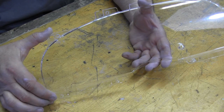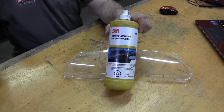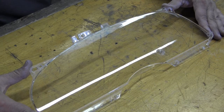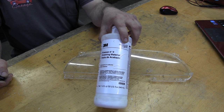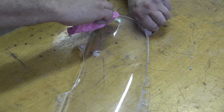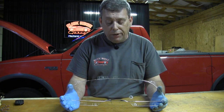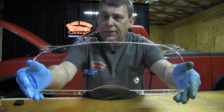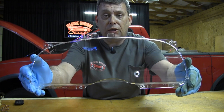When the polishing is complete, the defect should be gone and the light swirl marks left behind will come out in the next step. For the second step, we're using 3M's medium duty rubbing compound and the same procedure — buff it in, smooth it out, wipe it off very gently, and inspect your work. Once the swirl marks are gone, we can finish it up. The final step is with 3M's Finesse-It finishing compound. Polish it twice the same way, then apply a small amount directly on the sponge and make one pass on the inside of the bezel. Now wash and dry it one more time and we're ready for the final inspection. Wow, what an incredible difference. After a little over an hour and some elbow grease, it's crystal clear. This process was born in 1991 after I read on a can of Brasso that it can be used to polish plastic watch bezels, and a few more years of development led to the process you just saw.